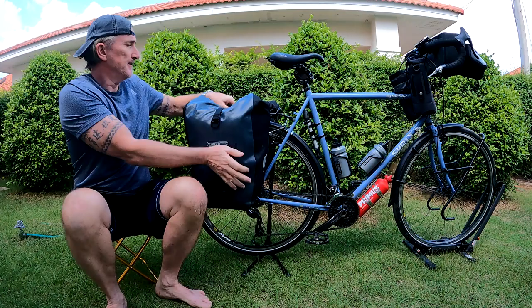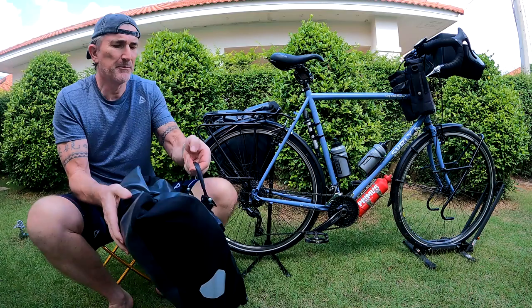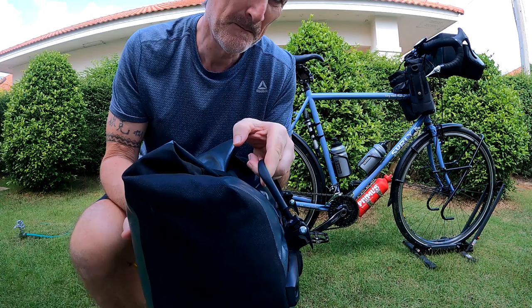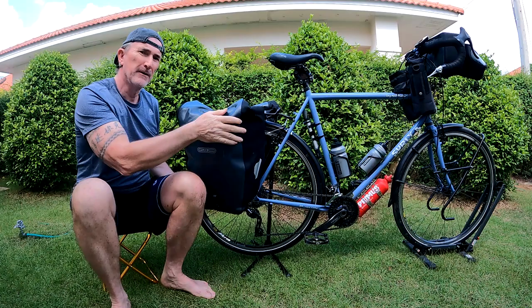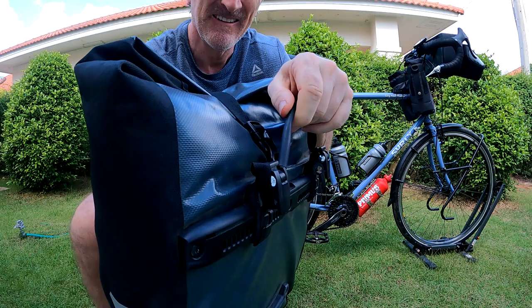And the other thing is sometimes when you pick your bag off the floor, you've packed your bag, you've been at the hotel, camping ground, you pick it up, it's possible to pick it up like this. And you can see here, the strap's actually caught around the hook. Now, if you put that back on to your bike, and you think, oh, that's fine, it's not. It could, in theory, fall off. So, always make sure that the strap, when you pick it up off the floor, isn't like that, it's like that.